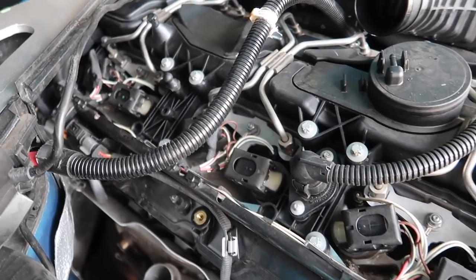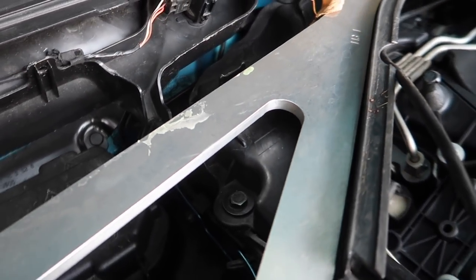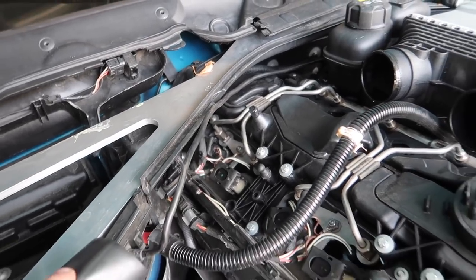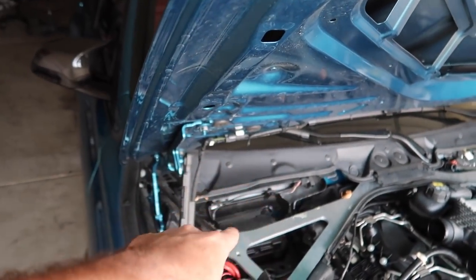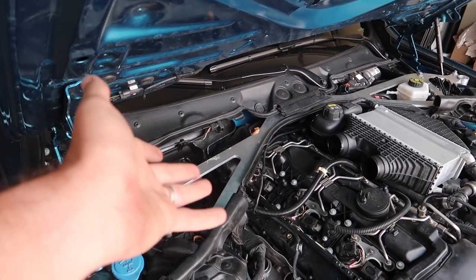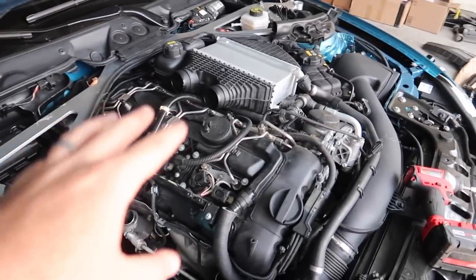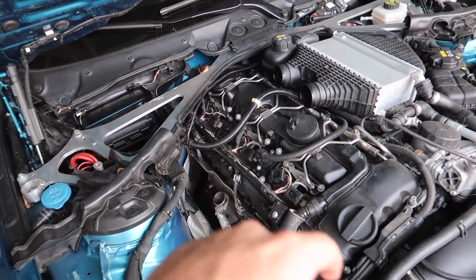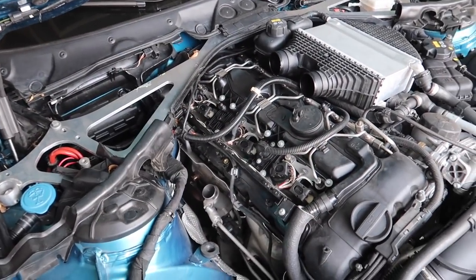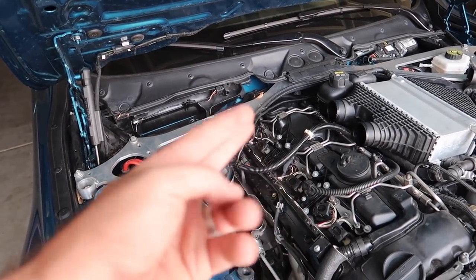So I'm trying to take out my spark plugs, but I just realized the sixth one is completely blocked off by this plastic and the metal strut. We have to move the metal strut and plastic just to remove that spark plug - you literally have to remove the carbon strut, the metal bracket, and all the plastic in back. It's not hard, just really tedious. I wish I had ignition coils for this car to do everything at once, but at least we'll do the spark plugs.